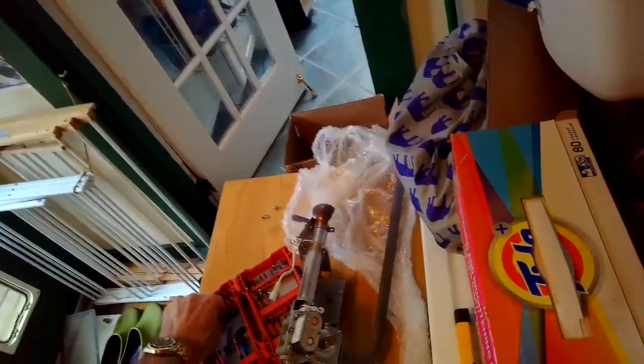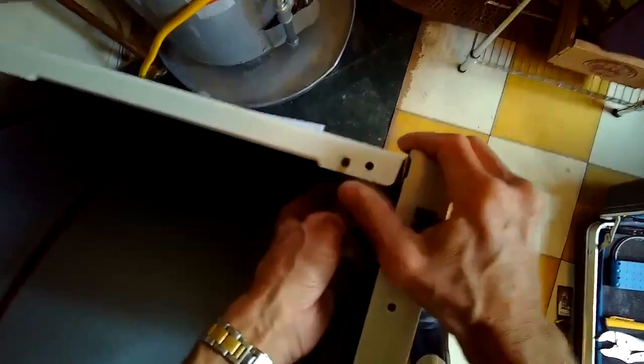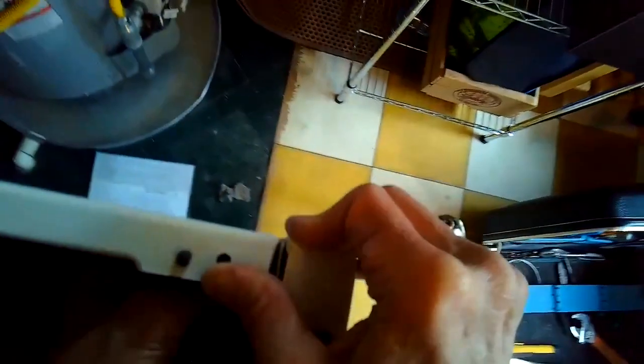So this dryer has some new life. It has that new gas valve assembly, has a primary and secondary new gas valves. It has a new igniter. So this is great. Could give this dryer maybe another 8 years of life. This design, by the way, by Whirlpool is awesome. These dryers often will get up into the 25 and 30 year point. You have to do a bit of replacement parts like we're doing today, but they're really good dryers.